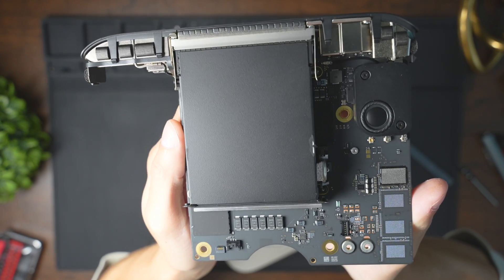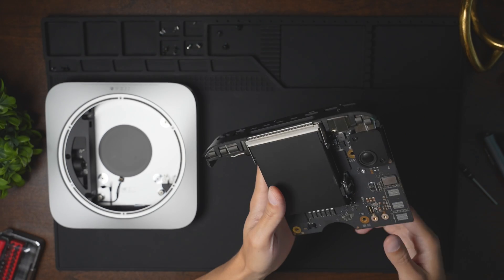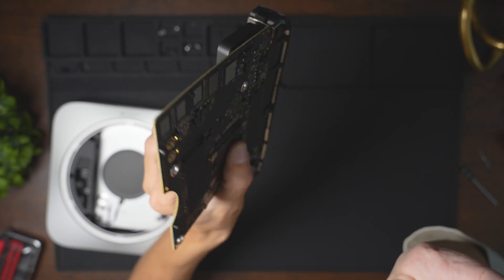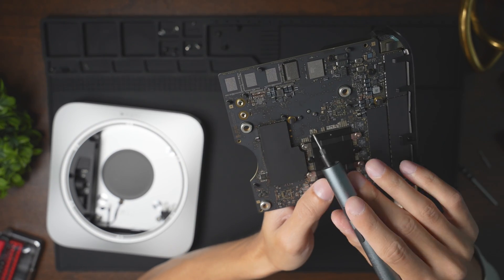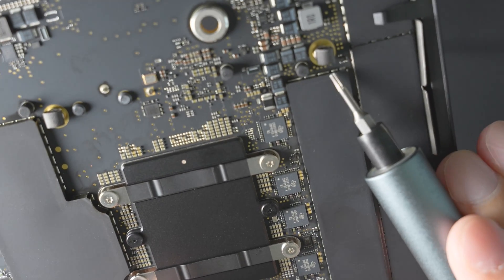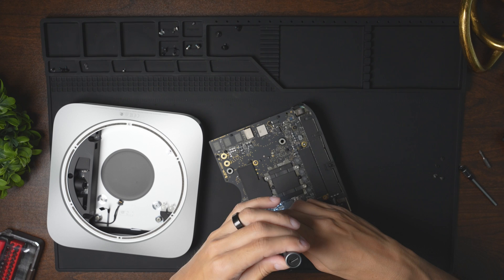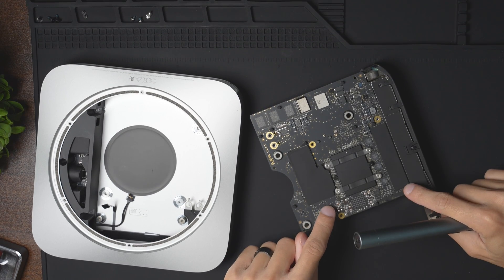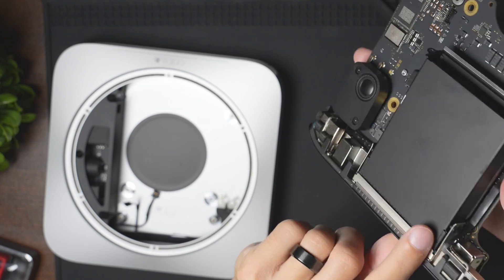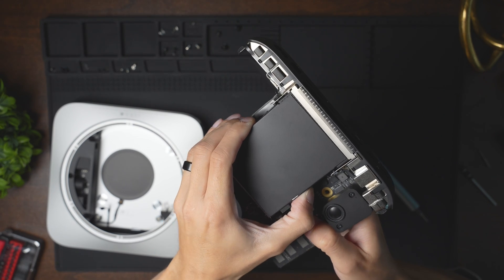For those who want a close-up, this is exactly what it looks like. The next thing we need to do is remove the heat sink cover from the logic board. First, unscrew the two bolts on the side. Then flip the logic board over — you'll see screws with gold rings and little black foam adhesive pieces on top. Remove those foam pieces and then unscrew those screws. There are also two more on the other side, so get those as well. Now the casing can just come right off.